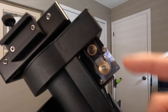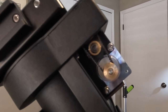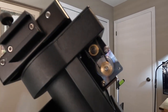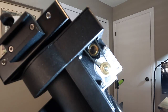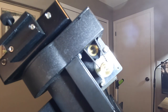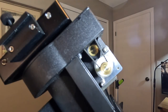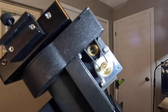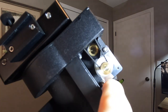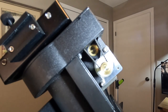Here's a side view of the belt you can see driving the worm gear from the motor. I'll put a little extra light on it — it's a little dark in this office. You can see the grooves on the inside of the belt which are catching on the gear and on the motor. Here are those two bolts that I loosened — push the motor out a little to add tension to the belt, then tighten those two screws down.